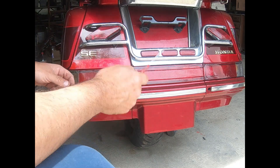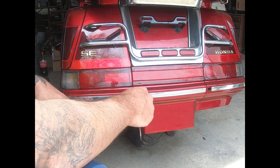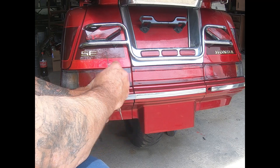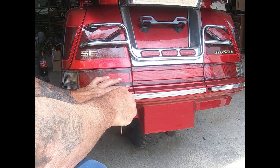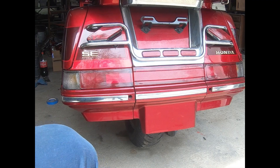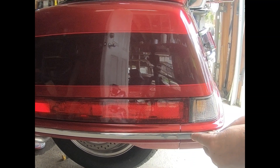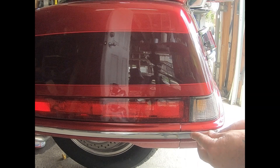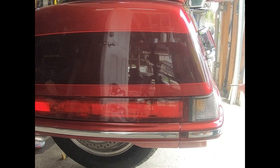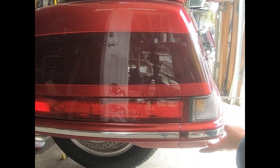All right, we have the brake master cylinder cleaned out now. We need to get to the rear caliper and also the front left, but right now we're going to do the rear — front to back. Gotta get this left-hand side box off. There's a little access piece here, just stick a pick under it and pull it off. There's another one on the side — stick a pick in it, pull it off. That gives you access to two Phillips head screws.